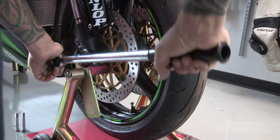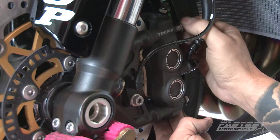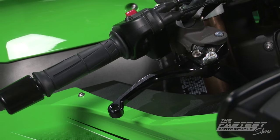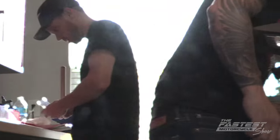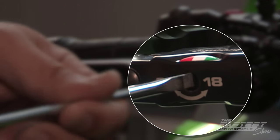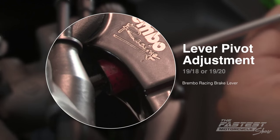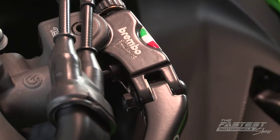From there we just work backwards: axle in with 94 pounds of torque, tighten the pinch bolts, and then reinstall our calipers. Now we're ready to move on to brake lines and a new brake lever. We're replacing the stock brake lever with a Brembo RCS-19 Radial Master Cylinder. In addition to better feel, it gives you the option to choose between two pivot configurations, either 19x18 or 19x20. Turning the adjuster screw to 20 will make the braking system more progressive and allow you more of a controlled feel, while a pivot distance of 18 provides a more race-like or aggressive feel.